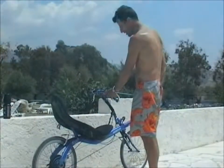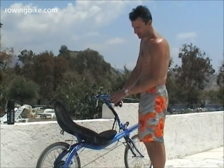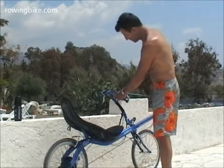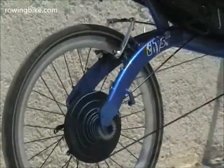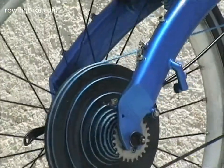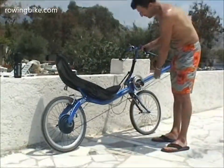If you have a flat tire on the rear, or if you have to change cables on the rear wheel, always begin with putting the bike in its lowest gear. So you shift back by making shifting strokes. And you put the foot slider in the most rear position.